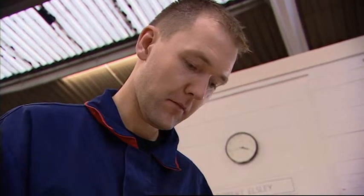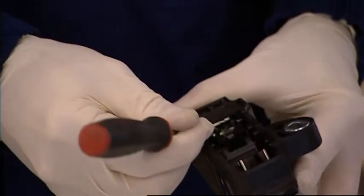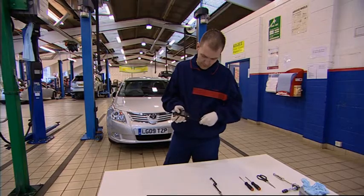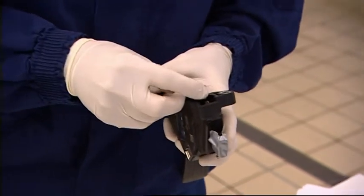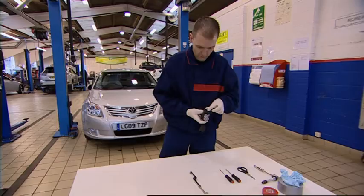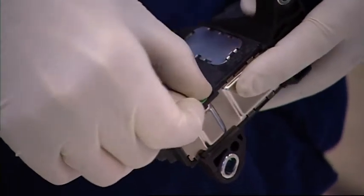When the technician has inserted the bar, he will then, from a different angle, confirm that it has been fitted correctly. The technician will then operate the pedal assembly 5 times. When the correct operation of the pedal assembly has been confirmed, the technician will then reinstall the accelerator link arm support cover. The technician will then confirm that the repair has been completed by attaching a green sticker.